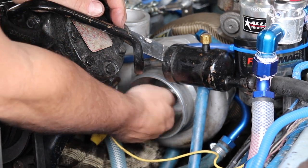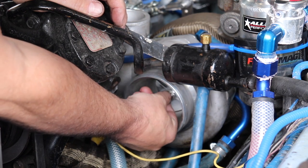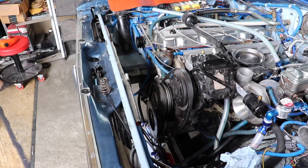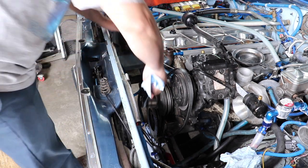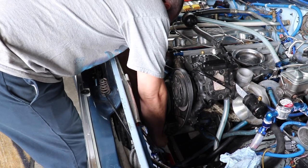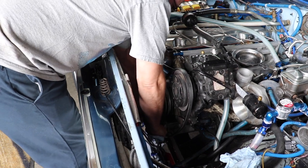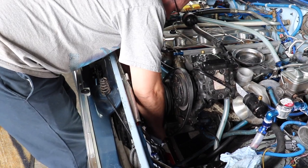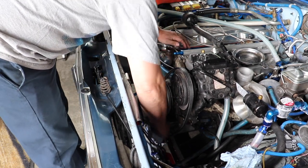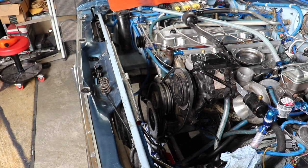As for the turbo itself, once I tore enough stuff above it to get to the impeller, although it still spun, it had a lot of wiggle to it — the journal bearings are gone on that turbo. It's fairly new, so I get to rebuild yet another turbo. I used the starter enough to keep bumping the engine around to get all the bolts off the torque converter from the flex plate so I could actually separate the engine.